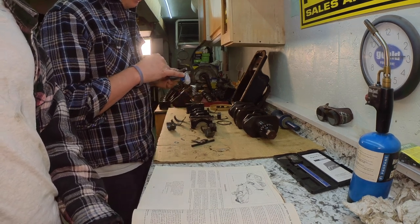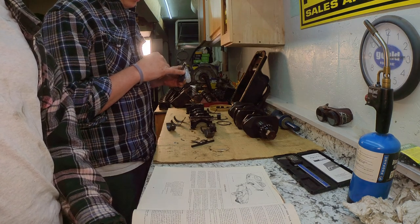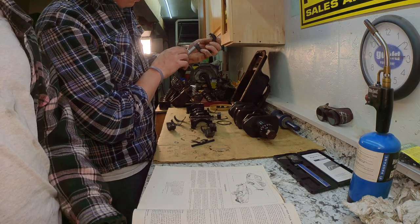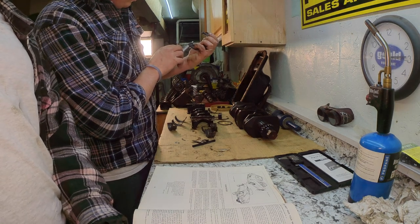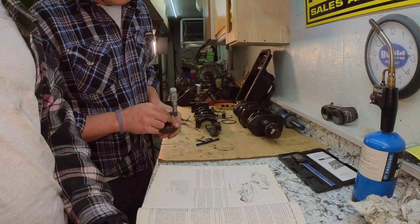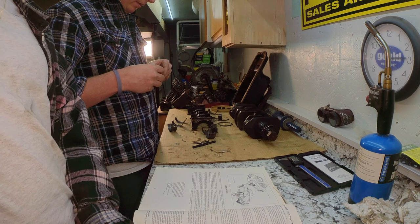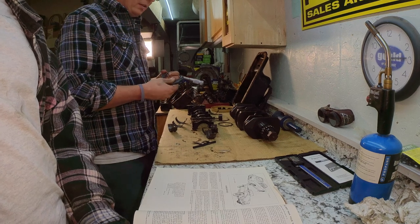So we're 875 plus, 1876. So 876, and then we look for the line that lines up the best, which I would say is the 9. So 8769. Round it off, that's 877. If you bring it down to a thousandth instead of ten thousandths. Yes, it is 8769.